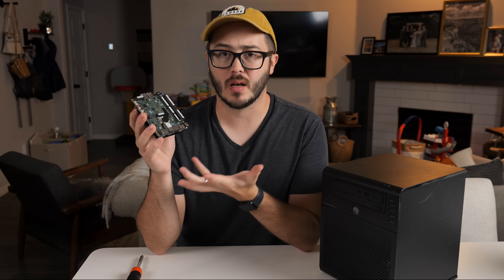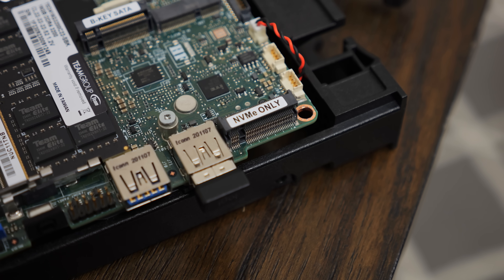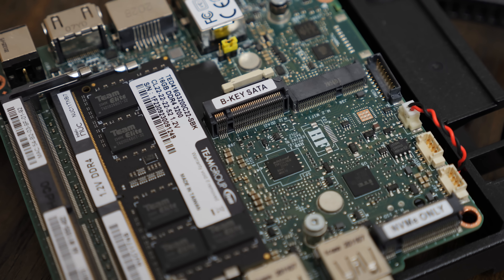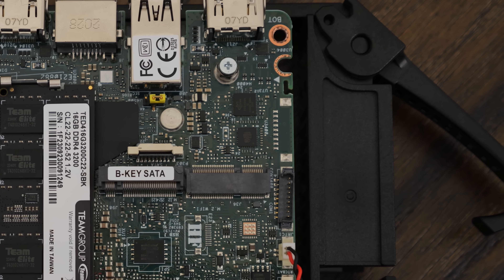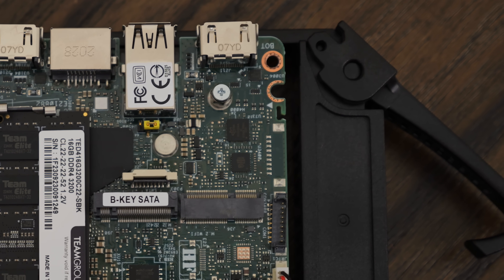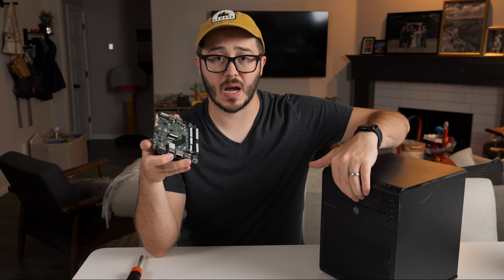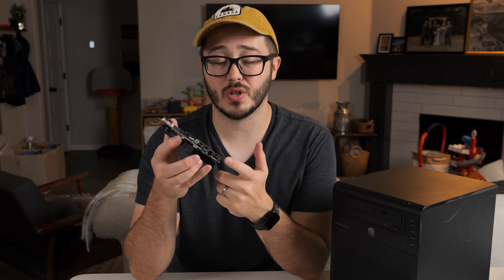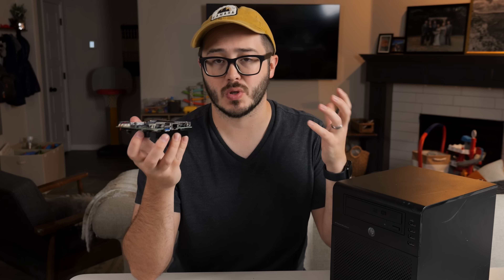While this might not look like it has a lot of ports, it actually has a good bit of expandability. It has a Gen 4 x4 NVMe socket, a B-key M.2 slot that says SATA but actually supports one lane of PCIe Gen 3, and another M.2 E-key slot which should also support one lane of PCIe Gen 3. With a few different little adapters, we should be able to make this work with not only the optical drive and the four SATA hard drives, but I'm also hoping to add a PCIe slot. On top of all of that, this comes with two and a half gig networking, which should be plenty for a server primarily built around storing and streaming media.